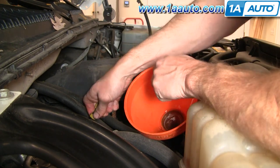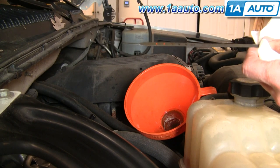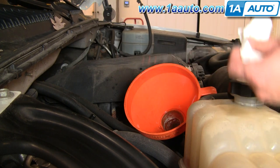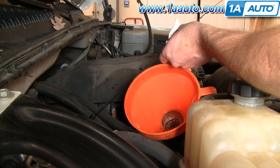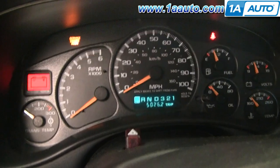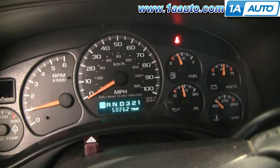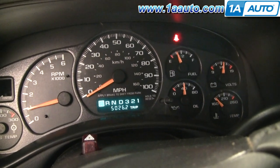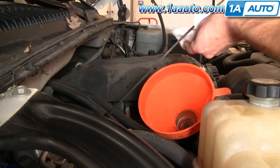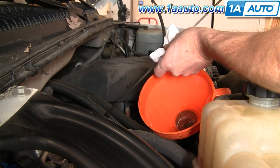Check the oil by making sure the dipstick's clean. Insert it all the way into the tube, then take it out — you can see that it's up to basically the fill line. So now we'll start up the truck, make sure we have good oil pressure, and fill up the oil filter. Here's your oil gauge. You start up the truck, and after a few seconds the oil pressure will come up. Let it run for a few seconds, then shut it down. Check the oil one more time — you should find it's about a quart low, because the oil flowed into the oil filter. Add another quart.